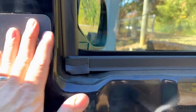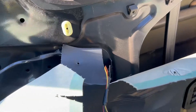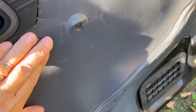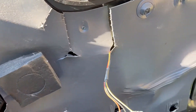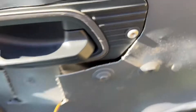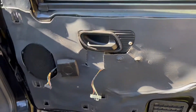Next step: you're going to put your moisture barrier back in place, top and bottom. And it should stick back in place for you. If it doesn't stick back in place, you can go to the auto parts place and buy some more adhesive. If it sticks back, by the time your door panel gets seated it should be in good shape. You got that one for your mirror and then you got the main one for your door.